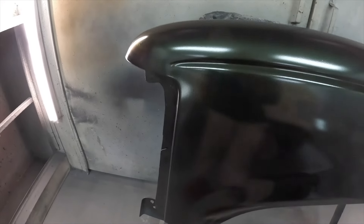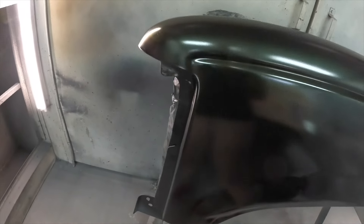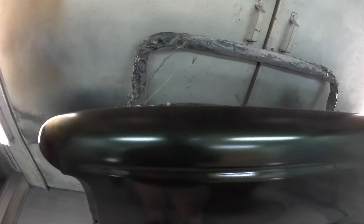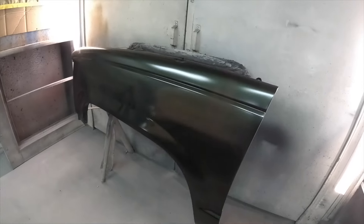This is after two coats of base. You can see the peel in the base after the two coats — it just didn't lay flat at all, after starting off at 29, then bumping up to 35. I actually do a third coat at 40 PSI — at the max, well, the max is 42, but I bumped it up to 40. And it sprayed a little bit better, you'll see here, but it was already done for.